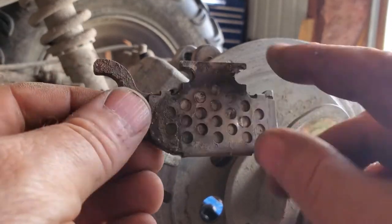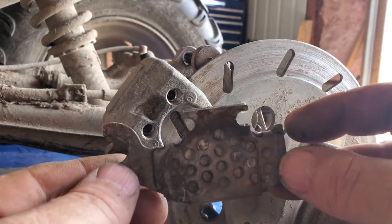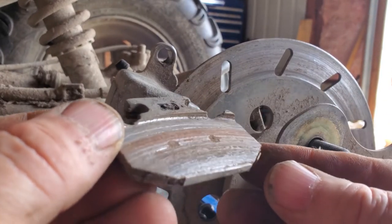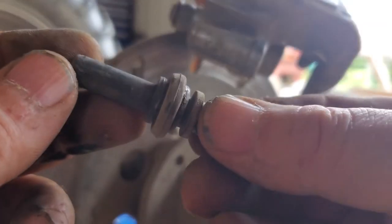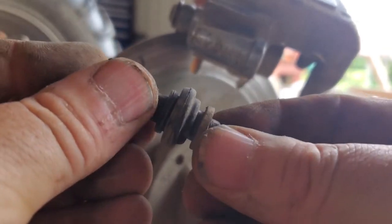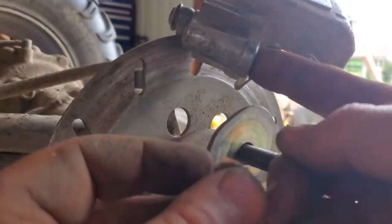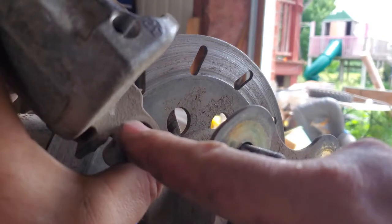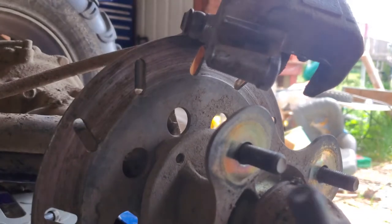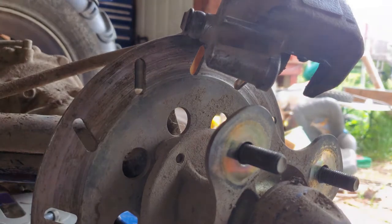There's your pad - you can see where the pins hold it in place. Once those pins are out it basically drops out, and there's the back one which was really bad. Here's our pin - it's got the rubber part on it, it's supposed to be greasy, and it is dry as a bone with old dried grease on it. So what we're going to do is use some penetrating oil, drop it in the hole to help loosen up the dried grease that's in there. We're going to clean up both pins on the wire wheel, put in some fresh grease, and put this back together.